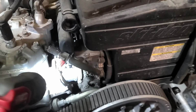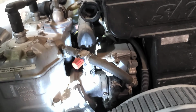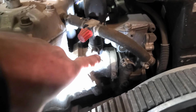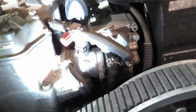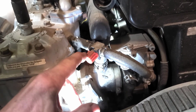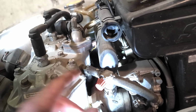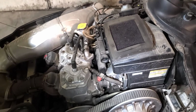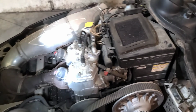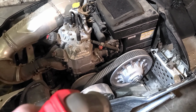I'm gonna have a quick look here at the intake boots. Just from a glance, you can blow your motor if the intake boots seem to be cracked. They'll suck air, it'll run lean. I see it has heated carburetors. Everybody has their own opinion on that scenario, but we're gonna tear into this thing anyways once we finish going through it. And in general, it looks pretty good, looks pretty stock in here.